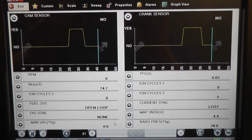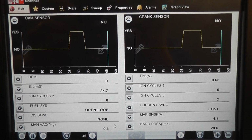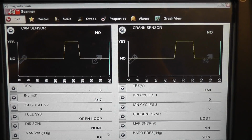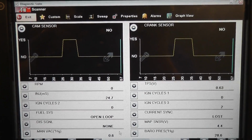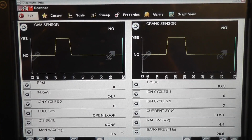For more information on this, you guys can refer to section 21, which is ignition system inputs, in my book, and also I believe it's section 22, no start, no spark diagnosis, which gets into all this stuff and all the variables. But that's it. Neon with a broken wire to the crankshaft position sensor.